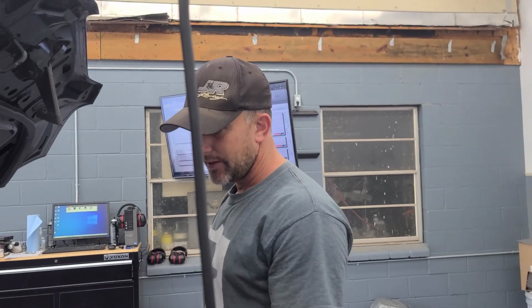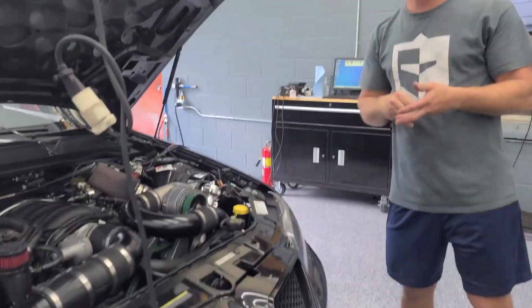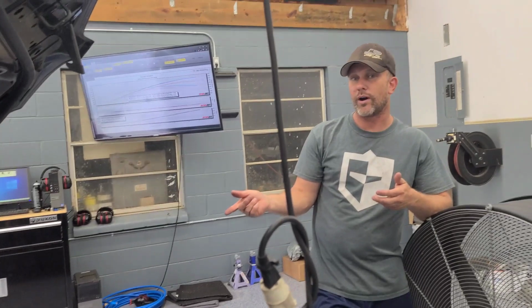So there's some improvements to be made, but that being said, this car made really good power. We feel like we're close to being up against a three-core intercooler, which is rated at 800. We don't believe it will. The D1SC with helical cut gears, so it's got the quiet option, with a 3.7 upper. So we can do some RPM calculations and see how fast we're spinning it, but